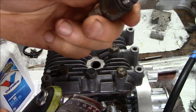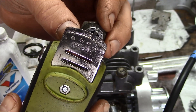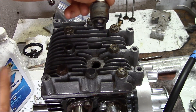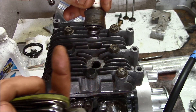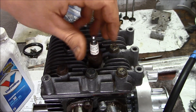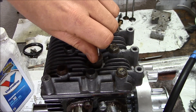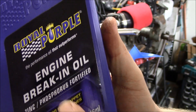The next thing we're looking at is the spark plug. I'm using a spark plug tool to check the end gap, which is about 0.03 inches for this specific spark plug. If you want to index the plug, it saves about 1 to 2% power. There's the ground strap side and the open side. From what I've read, you want the open end facing the center of the cylinder, though there are varying opinions on that — you'd actually need a dyno to test it.